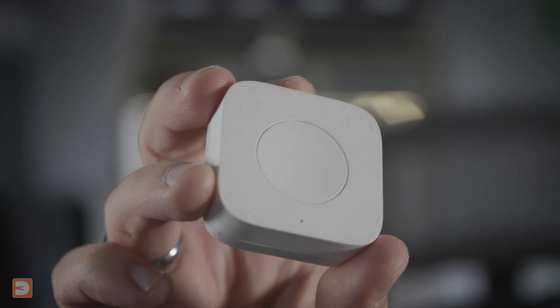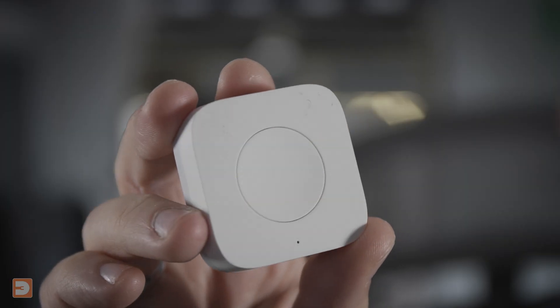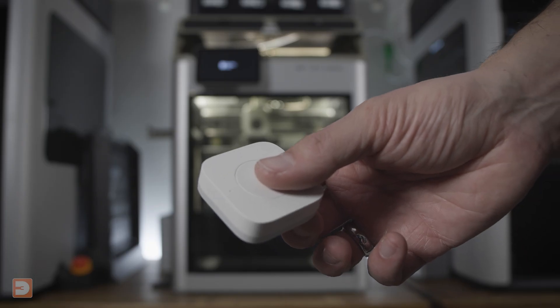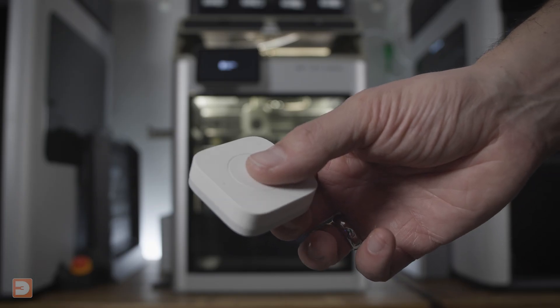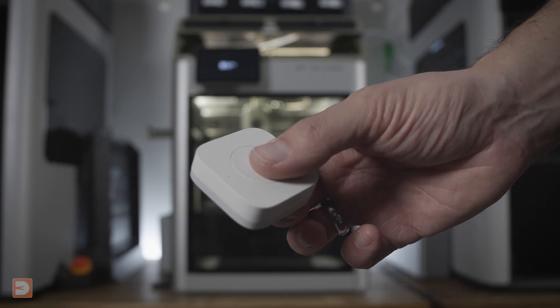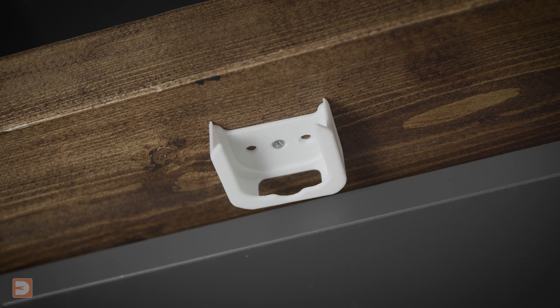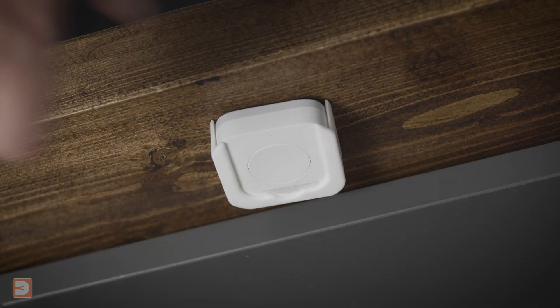These are wireless mini switches from Aqara. They're reliable, pretty cheap, and depending on their use case, they can last years before you need to change the batteries. They can be connected to the Aqara app and used in the Aqara ecosystem, but they run on Zigbee, so providing you have a Zigbee antenna connected to your Home Assistant, you can connect them directly to that. When I press this button, Home Assistant sees that it's been pressed and then turns on or off the associated smart plug. Whilst these switches do come with 3M stickers on the back, I've mounted these under the desk with a simple holder I designed, which I'll link to in the description.